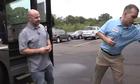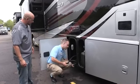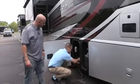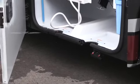One thing we've done new for this year — we heard concerns about wrangling big electric cords. These coaches are 50 amps, so the cords get a little stiff in cold weather. We now have a drop-down feature in the floor so you can run your cord and let it hang out, then shut your door and it'll close properly. Before, you were trying to run the cord through a hole while it's cold outside. We also have that same drop-down feature over here with our water compartments — for the sewer hose and garden hose as well. It's just adding convenience features to make the overall experience more enjoyable.